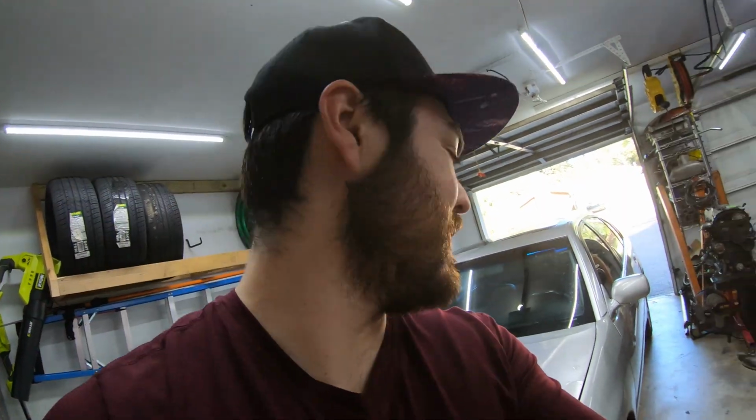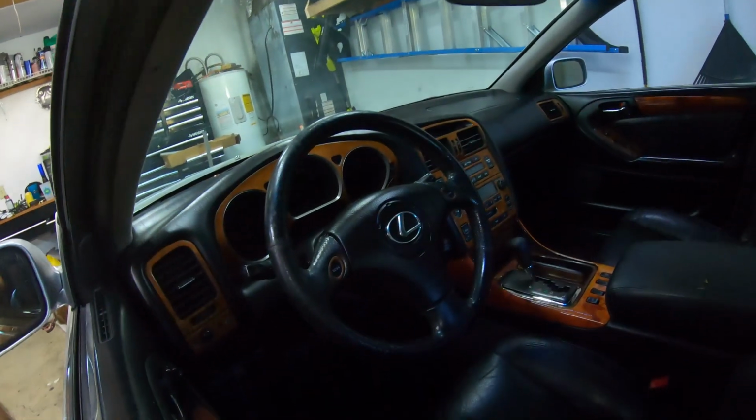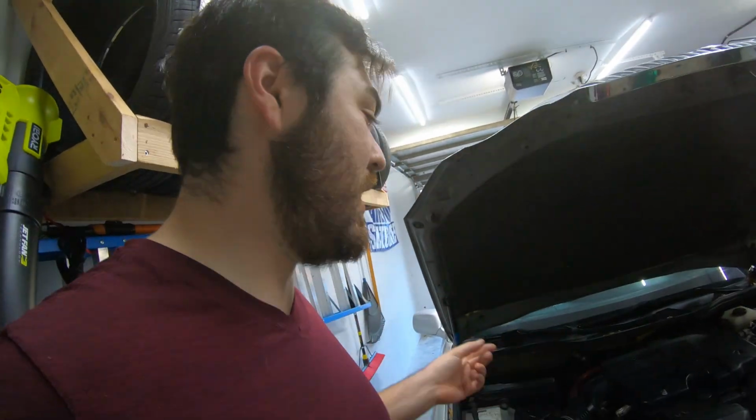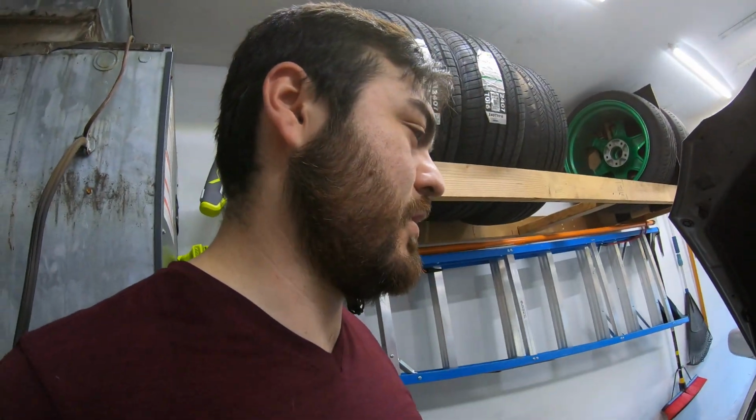It'll be a much better Jumba, but it's now daily mode engaged. So we'll make it good. Battery gonna die, but we got that squared up. Nice and straight. See if the steering wheel stays straight. Probably not, but who cares? It's close. We got the alignment zeroed out. Toe is looking good. I went and drove it. Steering wheel was just barely off. I ended up adjusting each side evenly to try to walk the steering wheel back to center. So we're really close now.